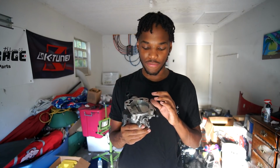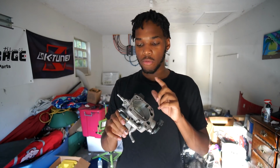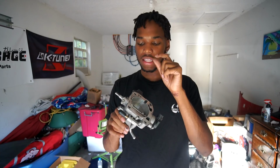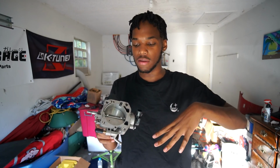If you don't follow me on Instagram, I had made a post about this. This is, I believe, a Blox throttle body, 70mm, and it started sticking, and I tried to fix it, and well, everything I did came to a halt because I didn't fix crap. After talking to the EF god, Mr. Young Static himself, I realized that my TPS didn't have the little spring in there, so every time I opened the throttle past like 3K RPMs, it would start to stick.